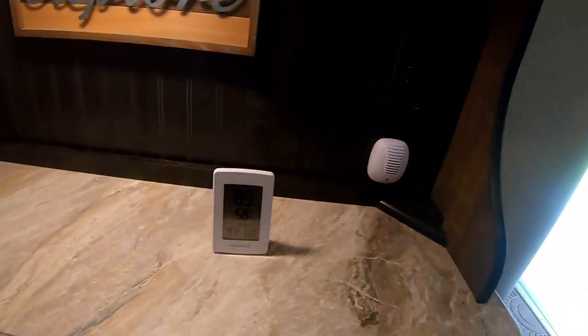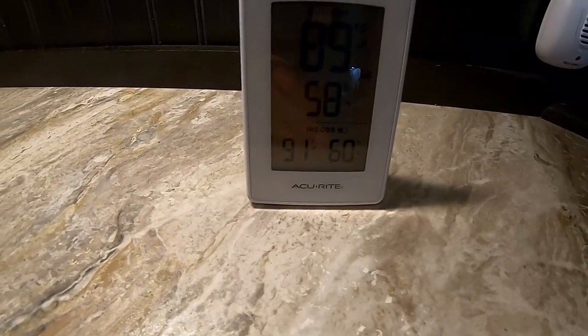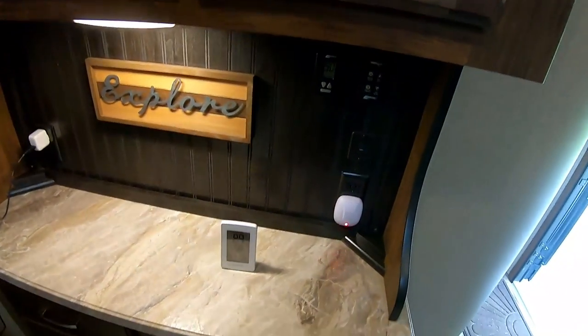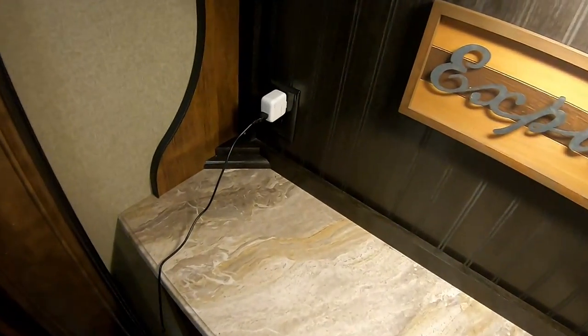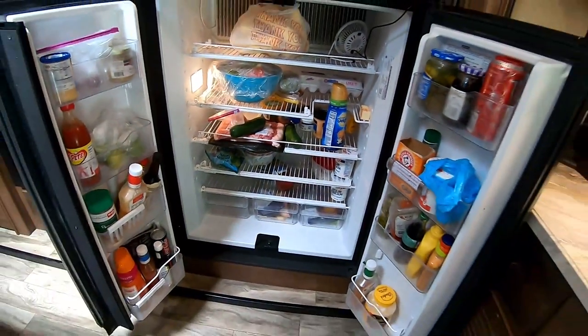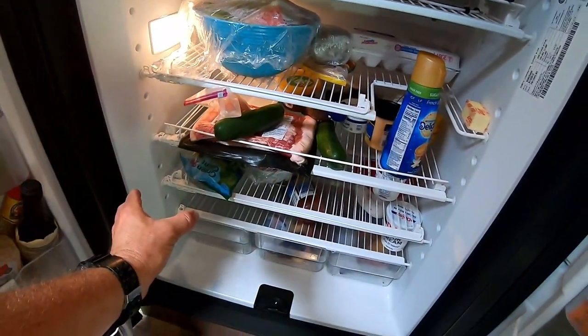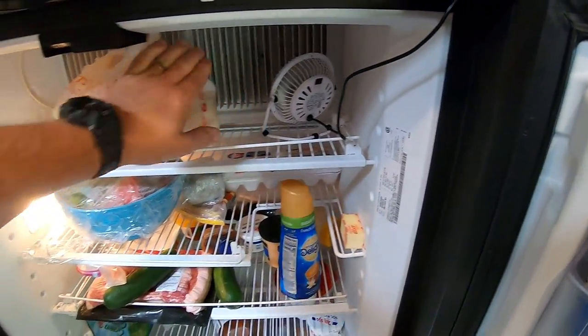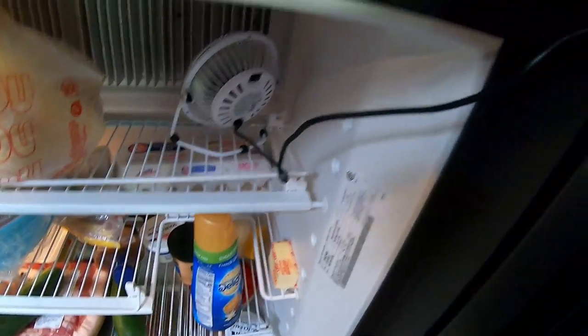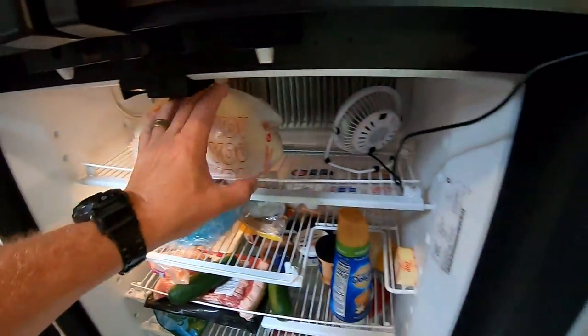Just want to show you what we've done — a real simple solution that has worked for us. In this camper right now it is 91 degrees indoors, and 89 outdoors, so it's a little bit hotter in here. Here's the trick: it's 33 in the fridge. The fridge has quite a few items in it — this is the 12 cubic foot Dometic. The idea is to have a one-inch opening around the sides of the refrigerator. What we did was take a fan — you want nothing in front of those blades or fins. It's plugged in with a USB device, plugged into an outlet, and that fan blows on the fins, constantly circulating air throughout this refrigerator.